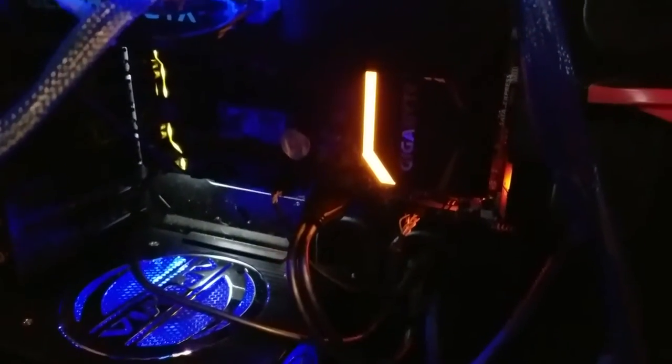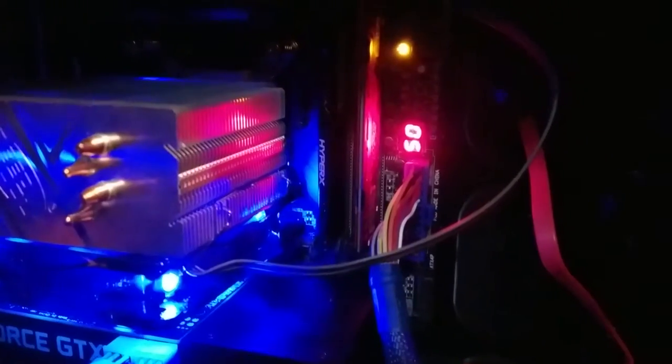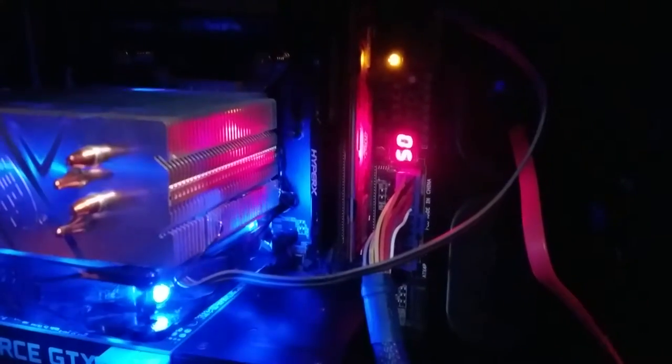So you get these LEDs. 60 means it's booting. But normally it goes to like 79 and 99, but nope — it settles in on 50, which is a memory initialization error. I have already done everything you can think of with the RAM, and it doesn't do anything.